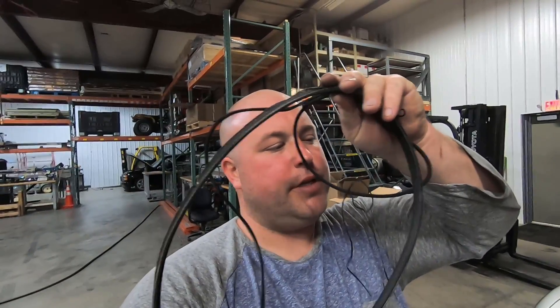Time for another update — we shredded another belt, unfortunately. All of the short-term fixes I made earlier didn't work. But what we did figure out is that the tensioner that was on the engine felt really notchy and the spring didn't feel as strong as it should be. So I ran back to the shop and grabbed the tensioner off of Alan's engine, installed it, and we're in the process of reinstalling the pulley and a new belt. The tensioner feels much, much better. Hopefully that solves the problem. Going to button it up, start it back up — fingers crossed.